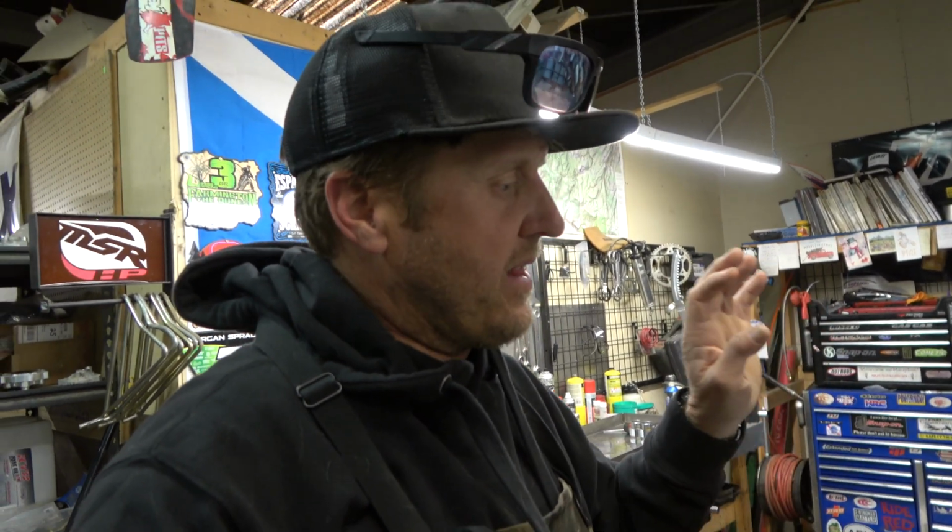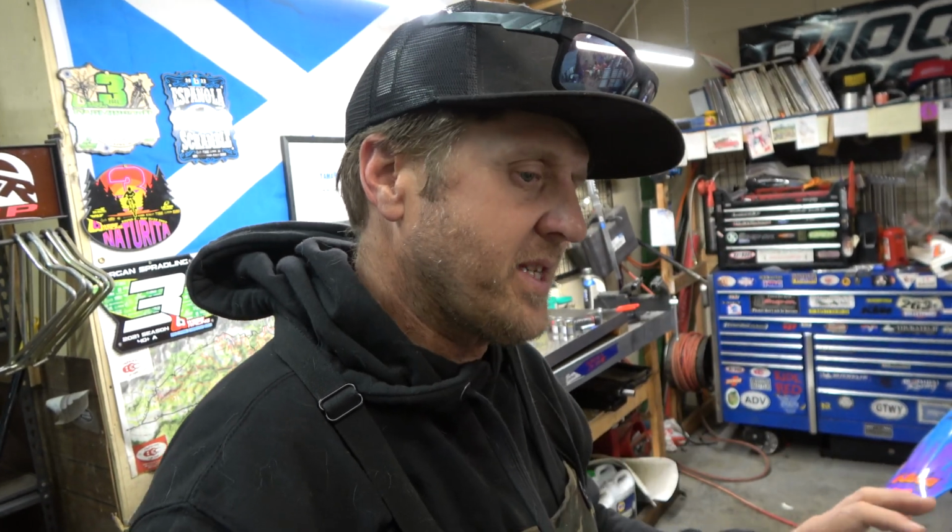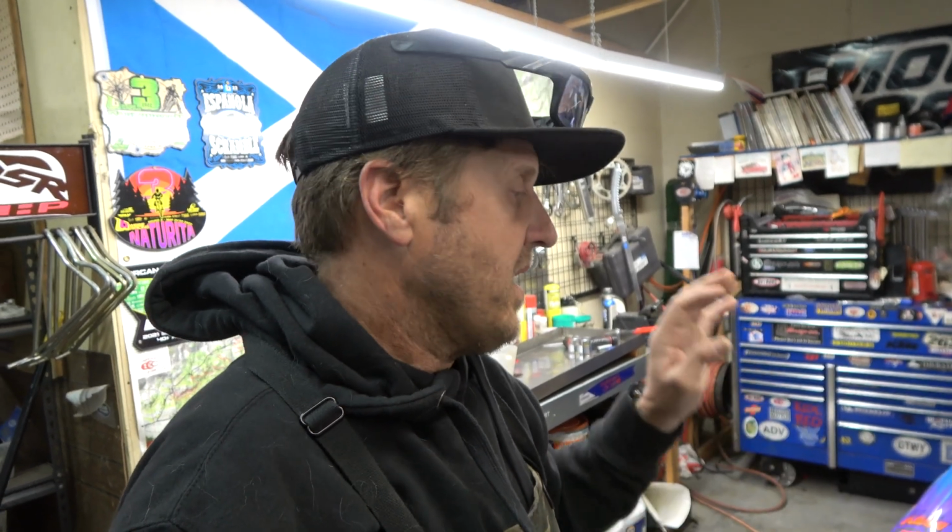I can also say that these things come valved for SX, at least this one is set up for that. You can buy them, I think you can probably buy them set up for different things. I haven't really looked into that. They all cost the same, and since we valve them, I buy whatever's available. I don't care if it's the SX version, the XC version, the XCW version. Again, I'm not sure exactly how the different versions come. They all cost the same. The parts are all the same. The valving's just different. So these are SX, so I will show you what that looks like.